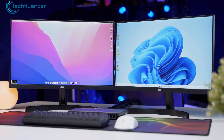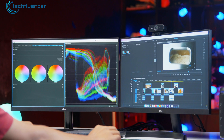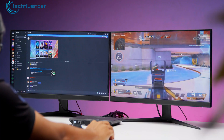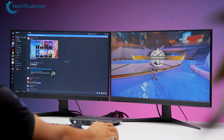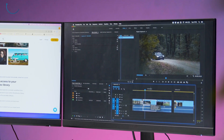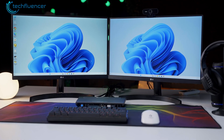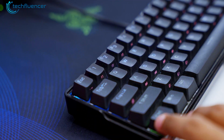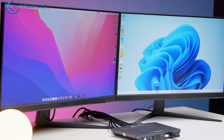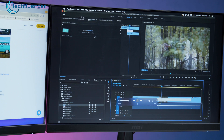The best part about this switch is that it supports both Windows and Mac OS. We've got our gaming rig with Windows and our editing rig running Mac OS, and this KVM switch handled them quite well. Switching between the two PCs was smooth — all we had to do was press the dedicated button on the front and we were instantly transported from our gaming setup to our editing setup. Switching was also very easy using hotkey switching, just pressing Tap plus 1 or 2. As this switch has EDID emulators in each input port, the process went smoothly without any flickering or icon mismanagement.